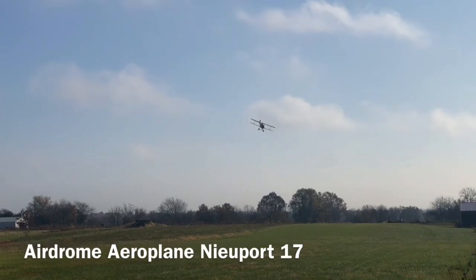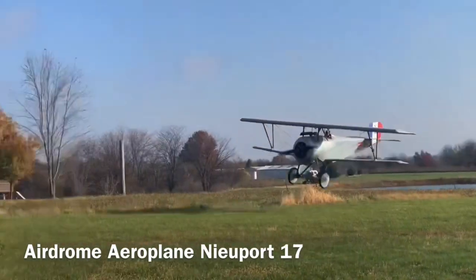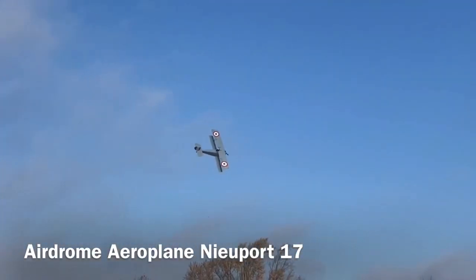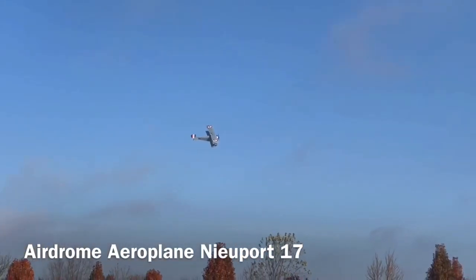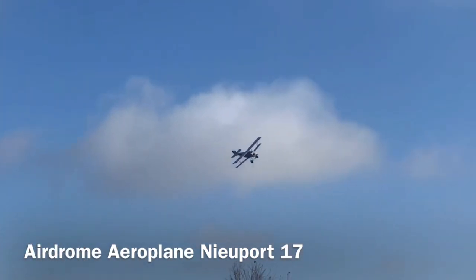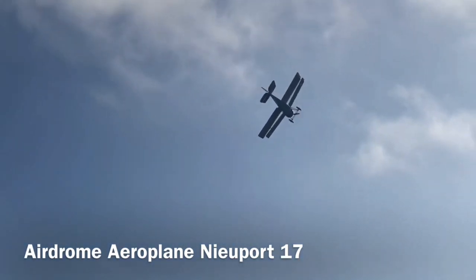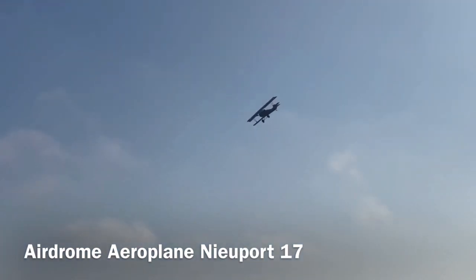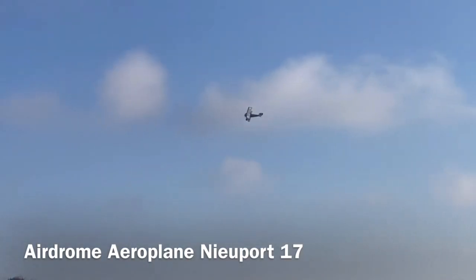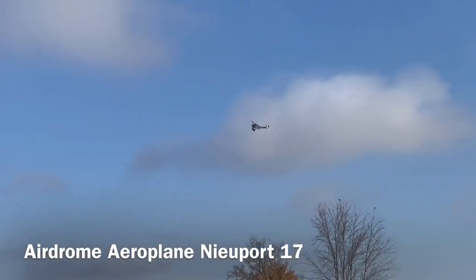I went with an 86 by 37, so the pitch is pretty low, which is related to the slow speed of the airplane — these are probably gonna cruise at about 90 miles an hour — and also the low RPM of the engine, cruising at around 1900 RPM. These planes are pretty light; all three came in at right around 800 to 900 pounds empty weight. Those engines have tons of power for them, so even if I didn't technically hit max RPM it was still okay because they have plenty of power.